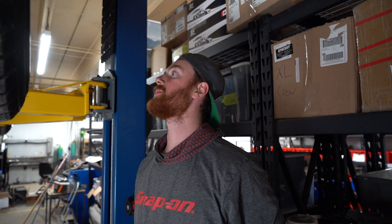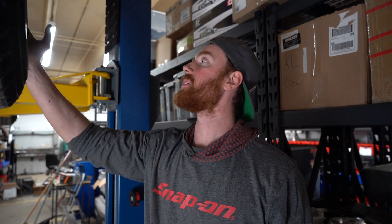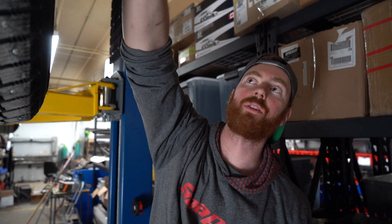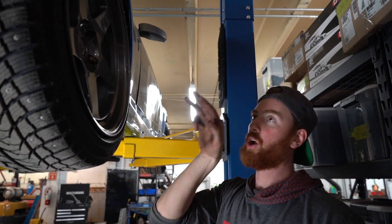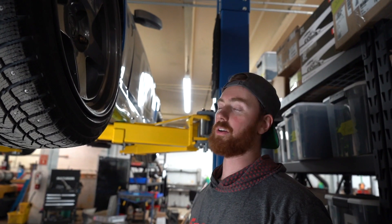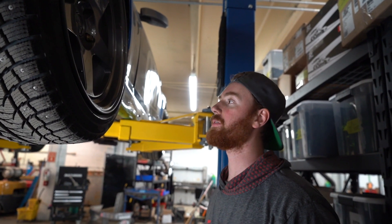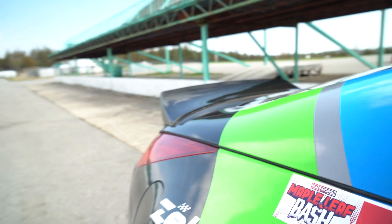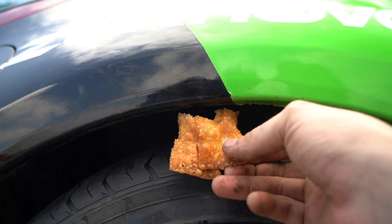We're going to move the caster back a little bit. I had this car aligned and the wheel was literally perfectly centered between my body kit — two fingers touching the front bumper and four on the back. So go three and three and that'll give me a general idea of how close I am; I bet it's within about half a degree.